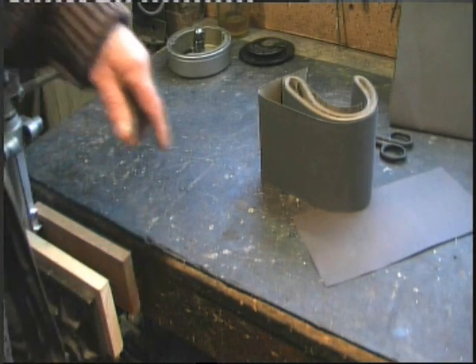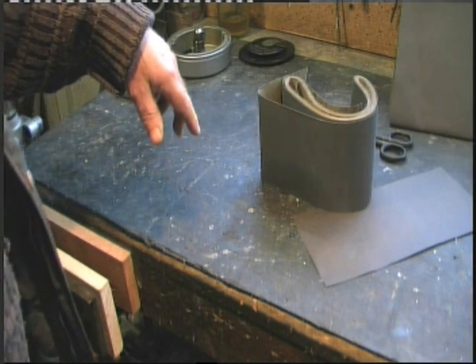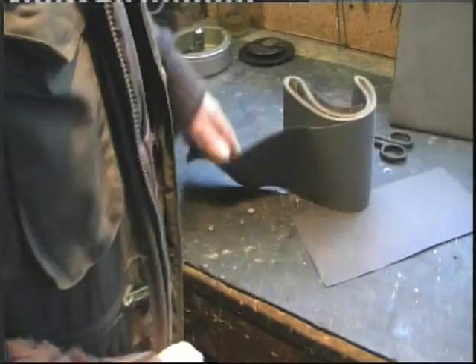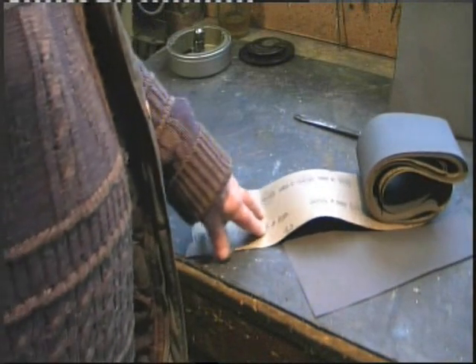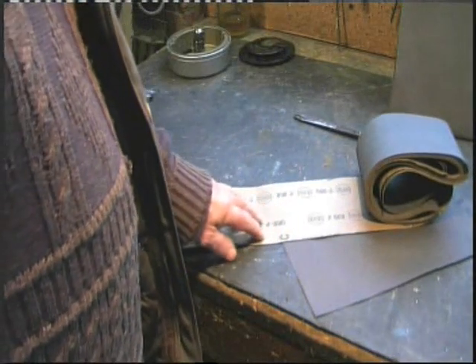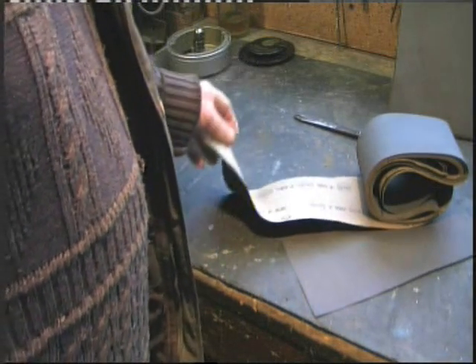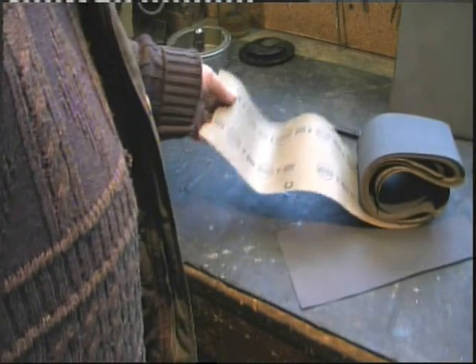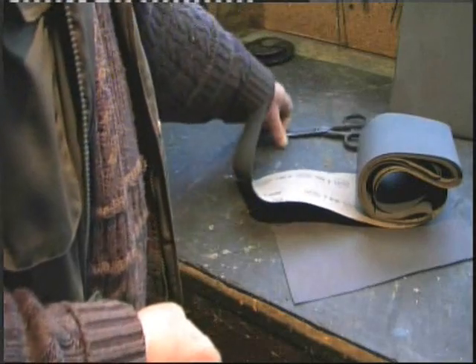In the event you haven't got any tabs and you're stuck, you can make your own, though as I say it's hardly worth it. Get yourself some crocus paper - that will actually cost you more than the tabs anyway. This, or it can be wet-and-dry paper. It needs to be extremely fine - 600 grit is absolutely the maximum coarseness you want; use 800 or more if you can get it.